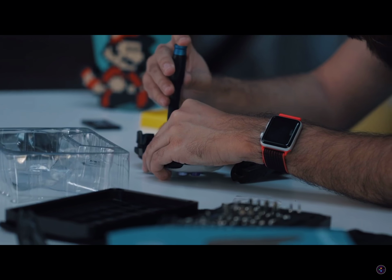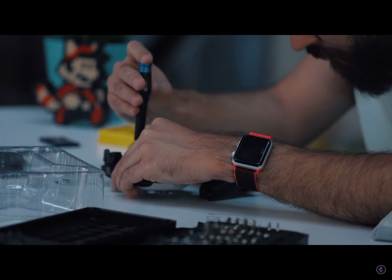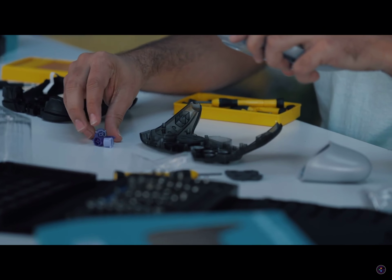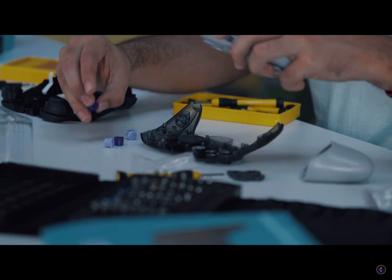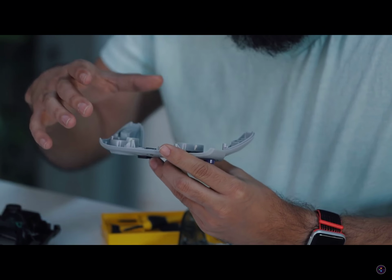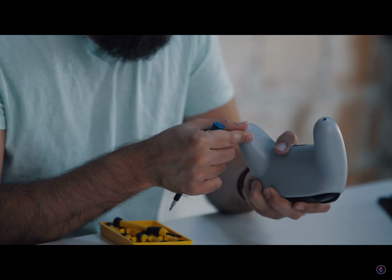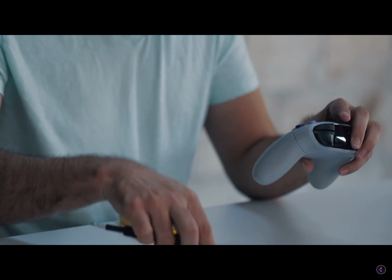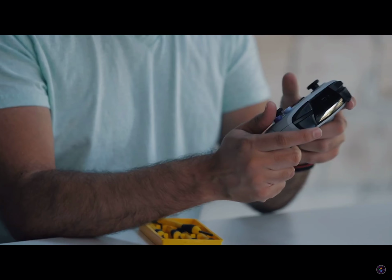It's very similar to the final steps you have to do for a Joy-Con shell exchange, which are super simple, and it's actually the easy part of that one, where all you have to do is take out a couple screws and then very carefully lift out all the different buttons and stuff and place them in the new shell in the same kind of way, and then just put it all back together. At this point, you're just re-screwing everything in, doing everything in reverse order, and bam, you have a brand new looking, awesome SNES Switch Pro controller.